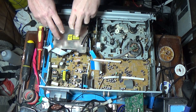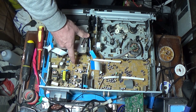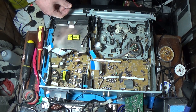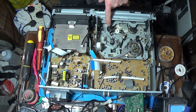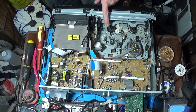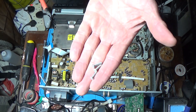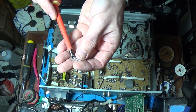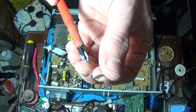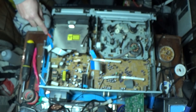Let's unplug this, stop the relay from clicking on and off. Have a look through some spare parts and boards and see if I've got a diode like that. To change it I'm going to have to take the front off, take the tray out, get to these screws. Remember where your screws go when they're different — you've got thick-thread self-tapping screws that go into plastics, and machine screws with fine threads that go into metal parts.